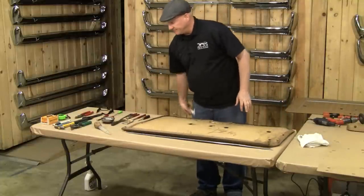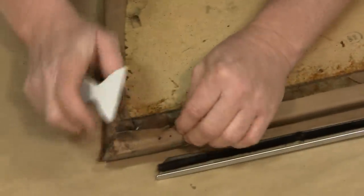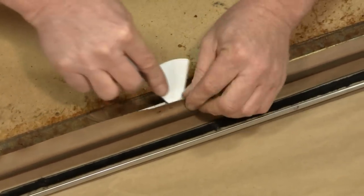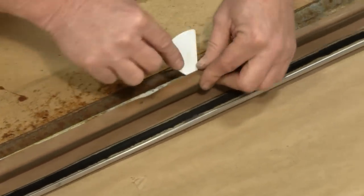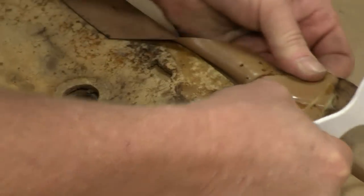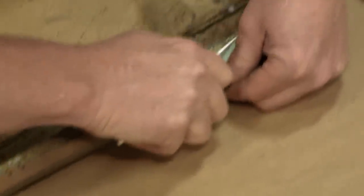The top of the panels and over the side are glued. What we're going to want to use is something very soft — not one of these — that will allow us to peel back and kind of slice the old glue out of there. Just want to continue down. There's also foam — it's a multi-layered panel; it has not only vinyl on it but also a foam layer. From the factory they overlapped all the vinyl and glued it down. You want to pull this back apart — just basically contacts in it — start working your way down, cut the foam back and out.